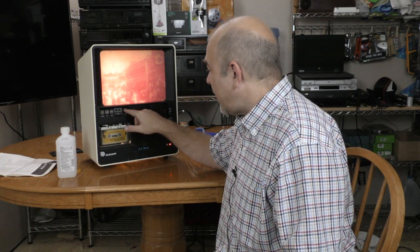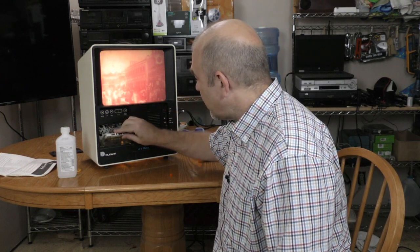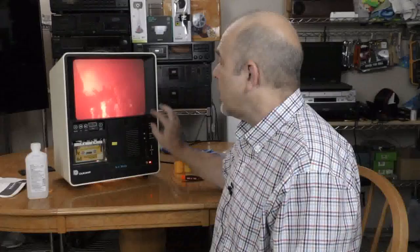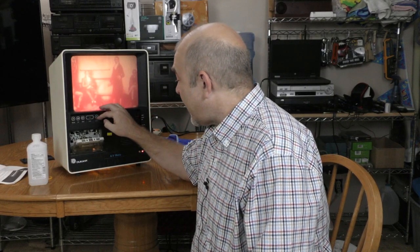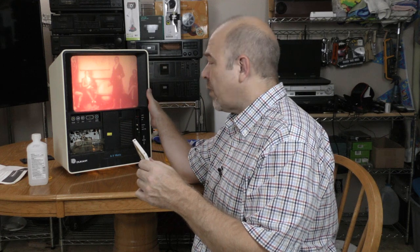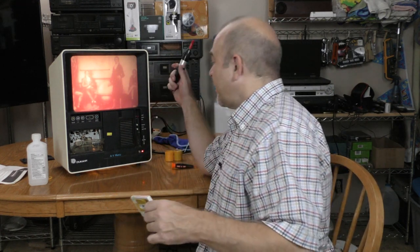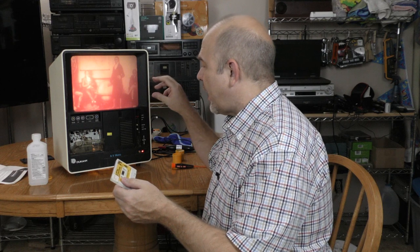This makes me curious — I want to hear the other side that doesn't have the automatic frame advance. I'm going to pop this out, rewind it, and listen to some of this. These audible tones do not advance the frame — those are for humans to advance the frame. So you hear the audible tone and you advance the frame yourself. So one side of this tape has the low frequency tones that are hard to hear, that trigger auto advancement, which I was also able to trigger using a 60 hertz demagnetizer. The other side has audible tones that do not trigger the auto advance, but you can hear them, so you can advance the frames yourself.